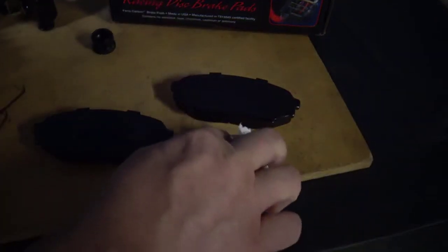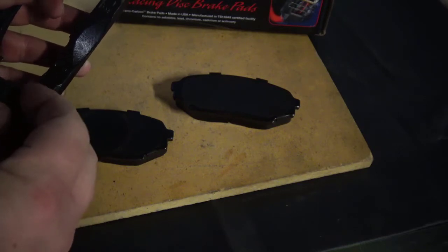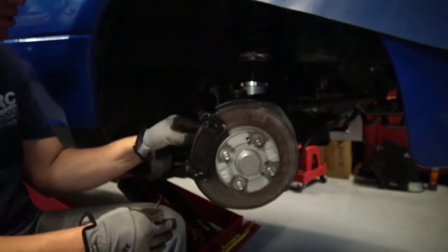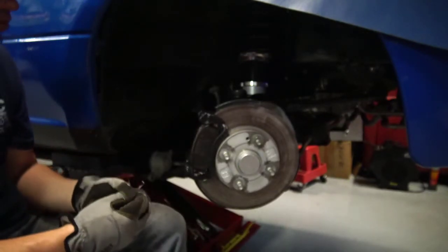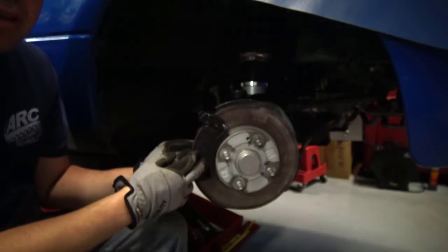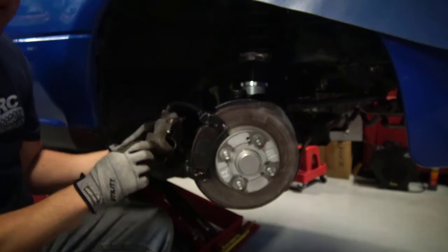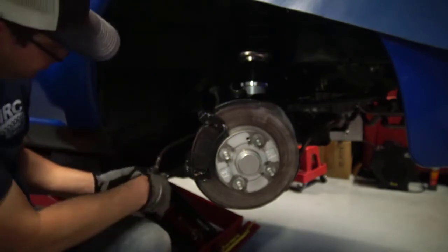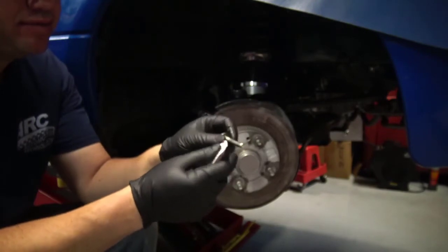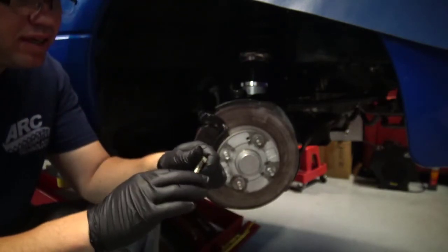We're ready to make sure our brake hardware is properly installed and put these pads on. With some finagling, you should be able to get both brake pads into position. The next tricky part is the anti-rattle clips — they want to spread the brake pads and make them fall right off. To keep the brake pads from coming out, I'm going to get the caliper piston ready. That means I have to apply some slide grease to the floating pin. I switched to latex gloves so I can grease up these pins while minimizing the spread of grease on the brake assembly.